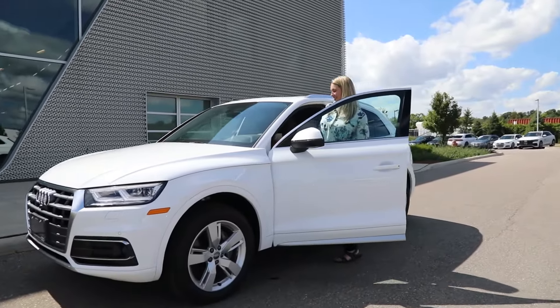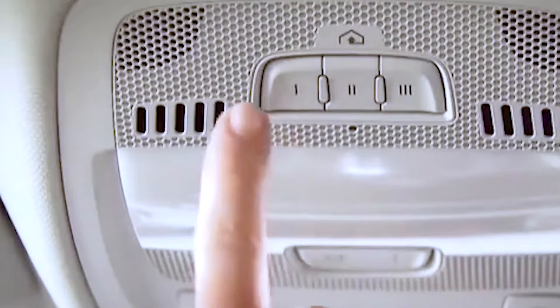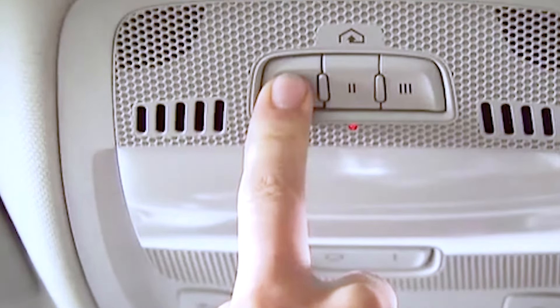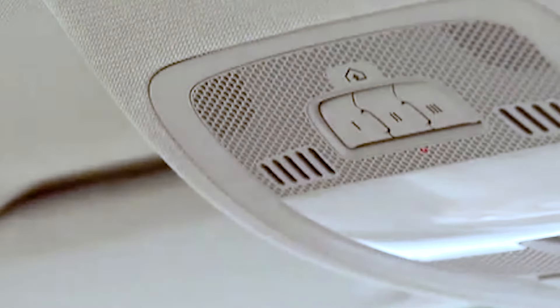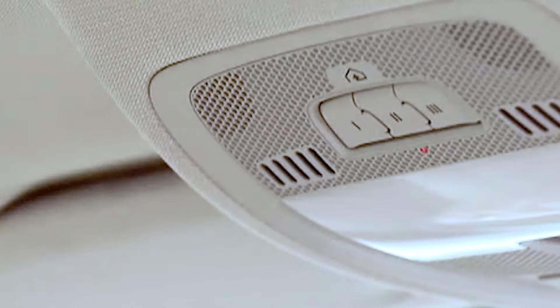Approximately 3 to 18 inches away. After the triple blink, get back in your vehicle and hold the button that you are currently programming. One of two things will happen. If the LED light is on solid, the programming has been accepted and your HomeLink system is ready for use. If the LED light flashes rapidly for two seconds then is solid, it means your garage door opener uses a rolling code and you will need to take some additional steps.